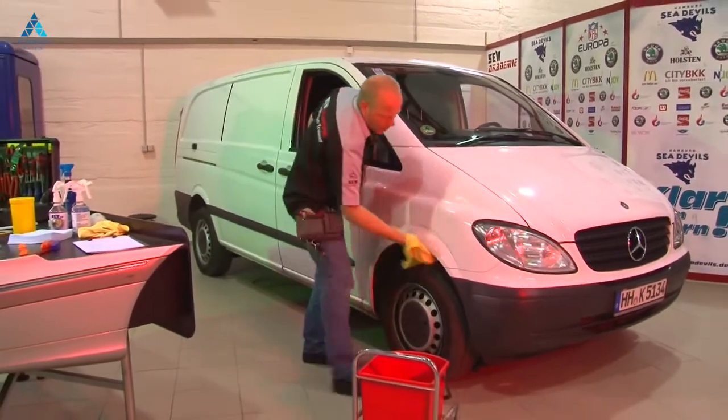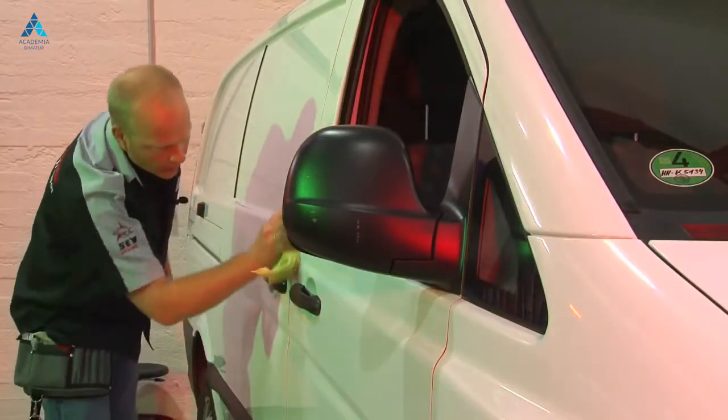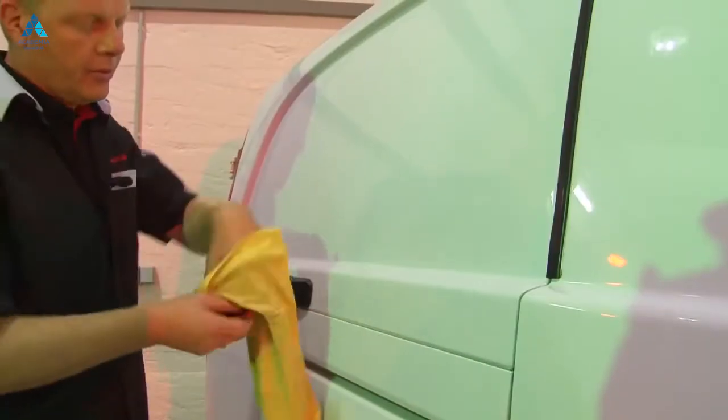As a precaution with new vehicles, ensure that the finish has had at least 6 weeks to harden completely. The vehicle should be cleaned in a car wash and parked in a heated hall for at least 24 hours the day before gluing, to ensure there is no residual moisture in the paint subsurface. The optimum room temperature during adhesion is between 20 and 22 degrees Celsius.